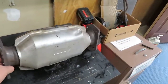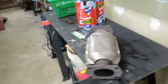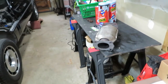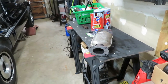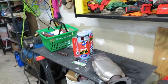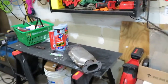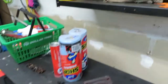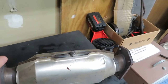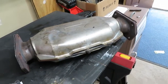The reason the catalytic converter had to come back off: when I was driving it around after filling it up with coolant, it had a whistle when you'd take off — once you got going it went away. I didn't have my camera so I couldn't video any of that. What I'm figuring it was is the tube that was in here — I cut it off and welded it up. Here's a small slideshow of that process.